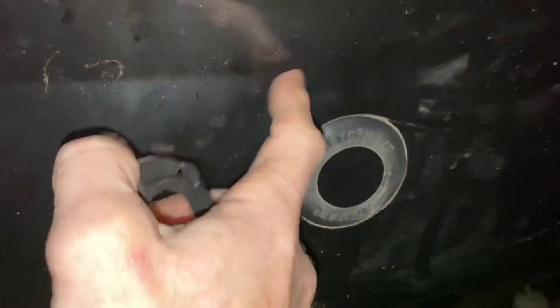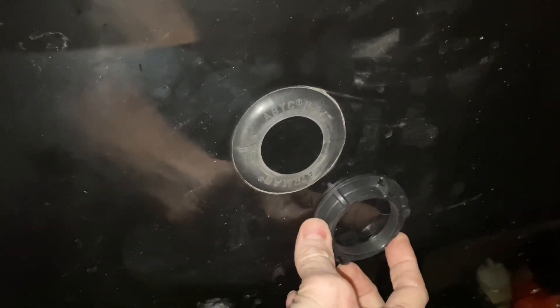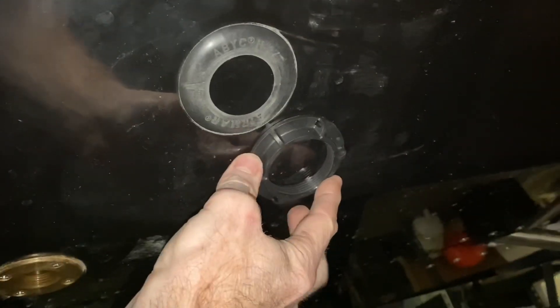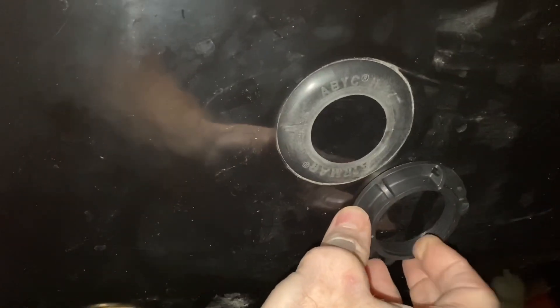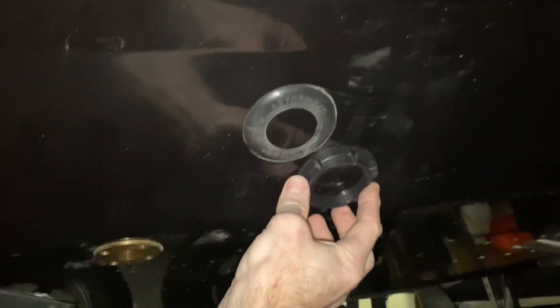It's pretty tight here — you've got a fuel tank right up in here and all the engine parts back here. You have to mount this on a flat section, so it has to be between here and here so that it will sit flat and flush. They say to mount it side by side, but then you're coming up on that angle right here. So I think it's better to offset it just slightly, bring it in from this angle, and put it slightly behind the existing transducer.